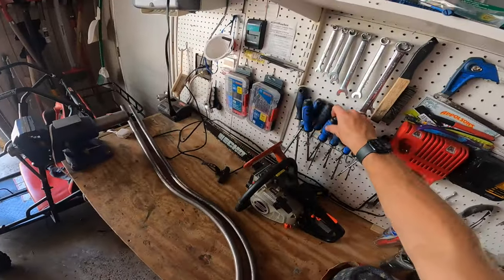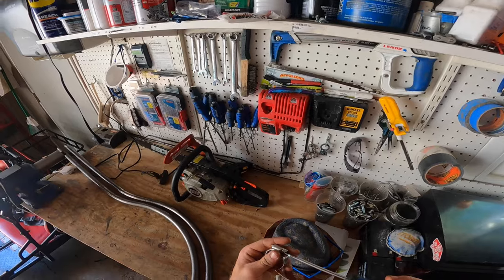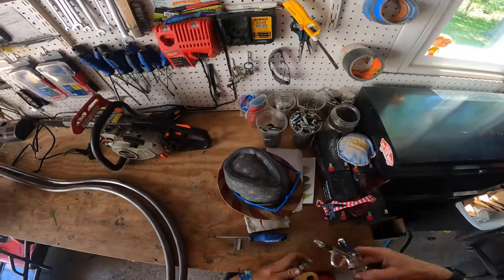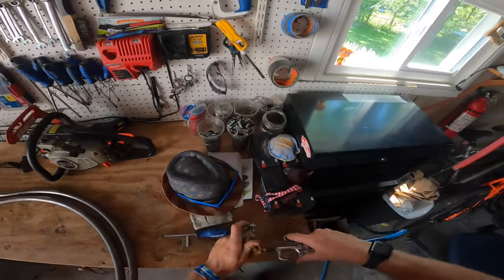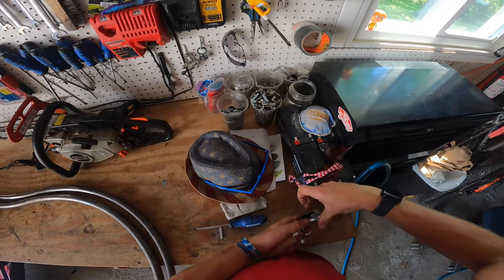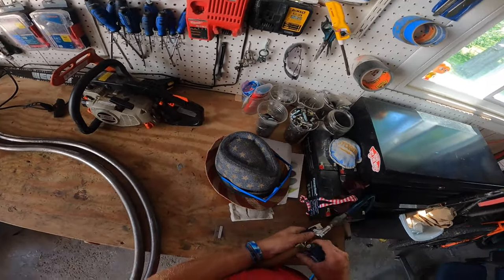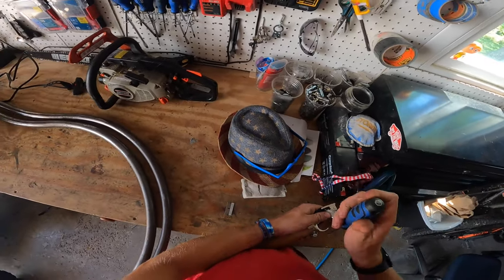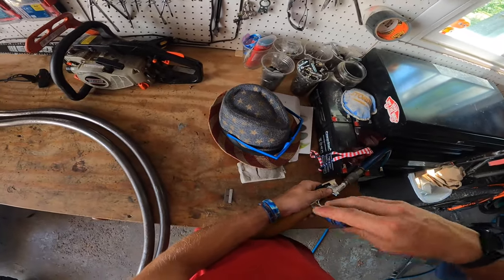That works pretty good. And whether you use the 5/16 bit or whatever that is, or flathead, doesn't really matter. All right, now that we have it loosened up, we're going to put the air gun into the end of the gum rubber. Make sure you put your clamp on there first. All right, and now we are going to clamp this gum rubber onto the air gun like this. So kind of hold it with both hands like that and then tighten it up.